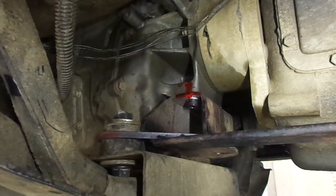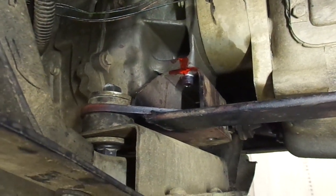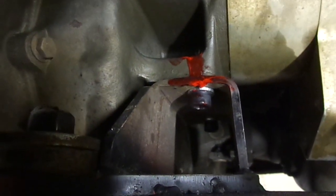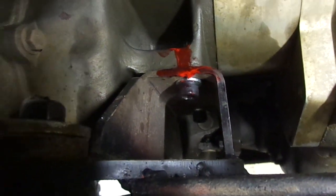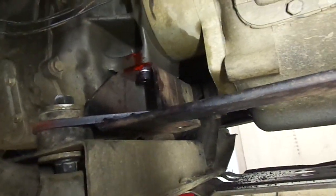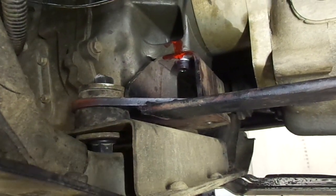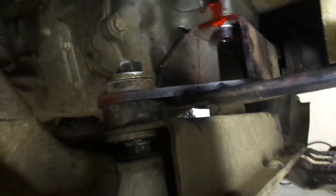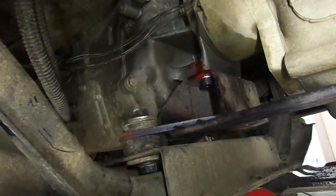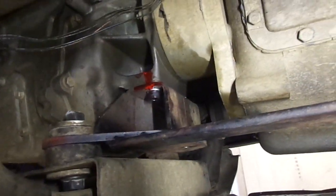I was driving home last week and I could tell something wasn't right — there was a strange vibration in the drivetrain. I crawled under it and sure enough, right where you can see that nice new black shiny bolt in the tail housing, both those bolts were snapped off and that mount was really angled downwards. It's because where it mounts the tail housing is behind where the mount ties into the crossmember, so the mount fits great but it has a pretty serious geometry flaw.